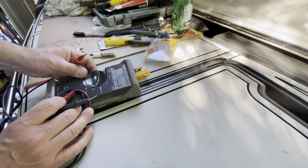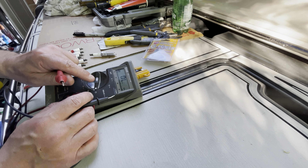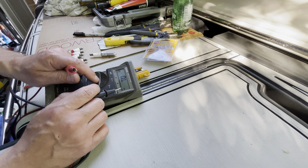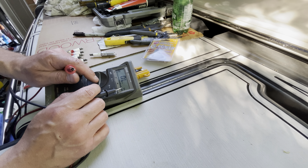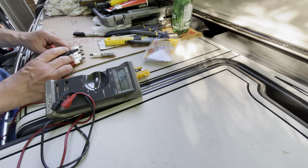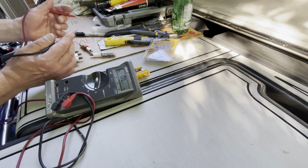So how are we going to test it? We're going to set the multimeter to ohms — I selected over here to thousands (K). I could test it set to millions, or smaller ones below 10, or right now I can set it to over 10 in thousands. The resistance will be noted in thousands, and what we are looking for is around five or six thousand resistance.